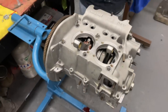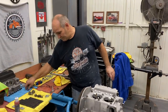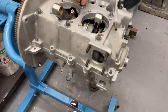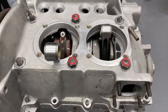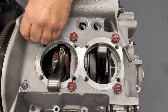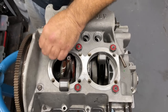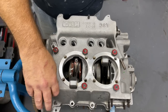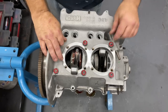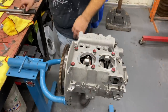I'm going to put the main nuts in first — torque the mains down first, then we'll get to the outer perimeter case nuts. We're going to torque these down to 27 foot pounds. You can find your torques online or in the Without Guesswork manuals from Volkswagen — also online. Good resource for torque specs is the Samba. It's 27 on the mains and 18 on the outers.